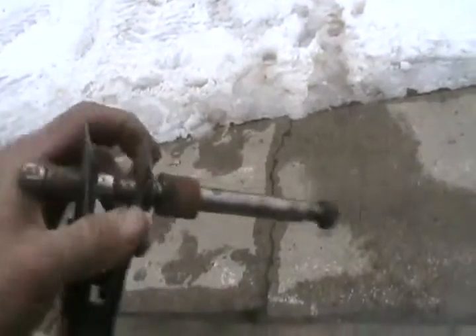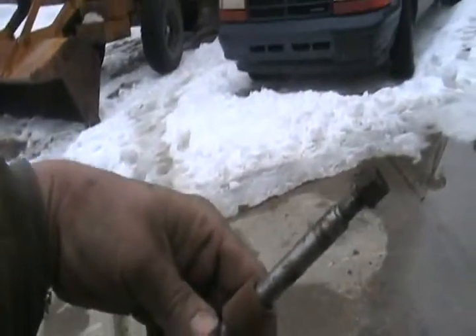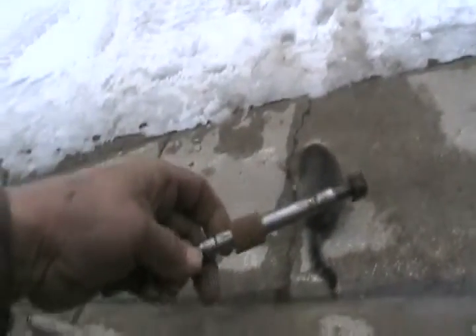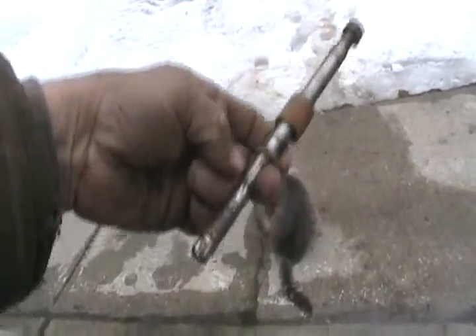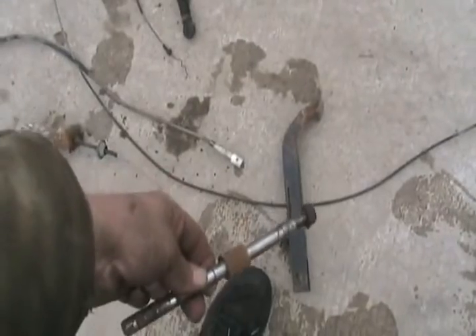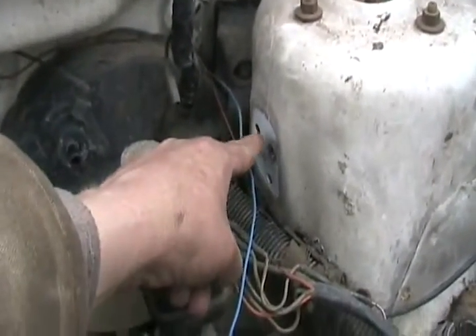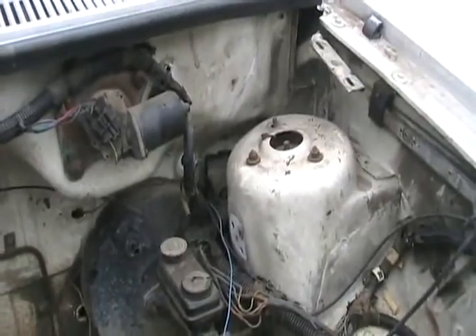Everybody seems to ask how you make a Chrysler vehicle into a standard with a clutch pedal. It's totally easy — this long rod just unbolts on one end and you pull it out. If you have an automatic, the rod is three inches shorter and that piece doesn't exist. All you do is unbolt it, slip a longer rod in, then shove a clutch pedal on. Couldn't be simpler. The shock towers on Chrysler vehicles have little plastic plugs covering the holes where the clutch cable bracket mounts, so they're already pre-drilled.